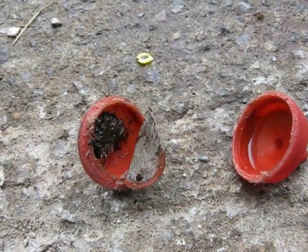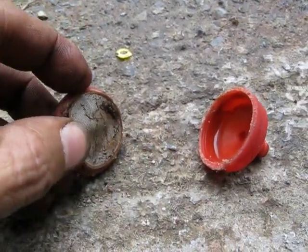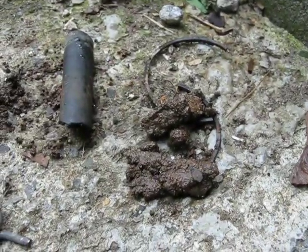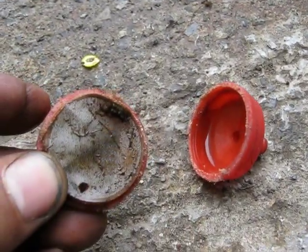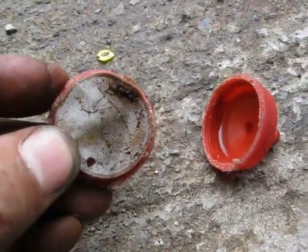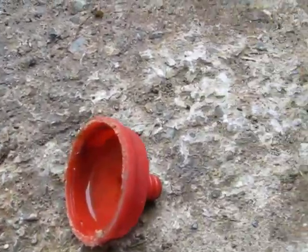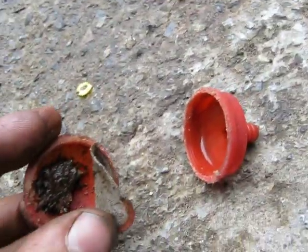So I decided to tear the fuel filter apart on the engine with the dirty bowl. There's the amount of dirt I took out of the bowl right there — that's a lot of dirt. So I dissected the fuel filter here. I punched a hole in the screen. The Briggs filters are a fine screen. One side of it was clean and then the other side had a whole bunch more dirt.